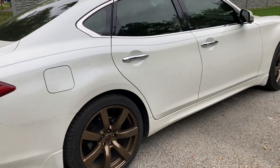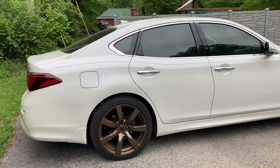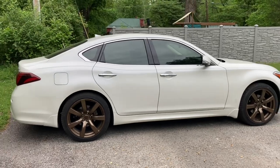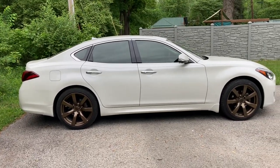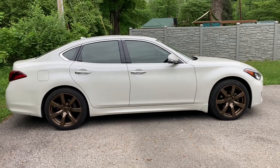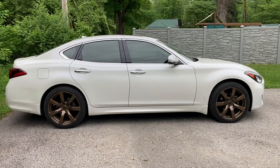Color does play a big part of it as well — got to admit that. So these are both front wheels, front GTR wheels. The spec on that is 20 inches in diameter, 9.5 inches wide with an offset of 45.